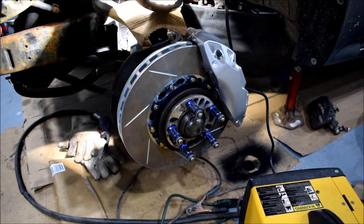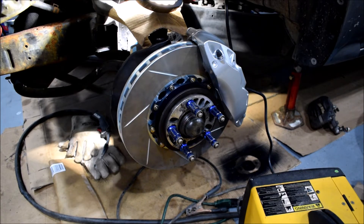I was expecting to post the completion of my big brake upgrade on the Tacoma this week, but unfortunately I'm not yet done. This project has turned into a massive multi-week undertaking. On the previous video you saw that I started out with the CTS-V brake caliper, which used the same size bolts as the stock Tacoma brake caliper — M12 — but unfortunately the holes on the knuckle and the holes on the CTS-V caliper were not the same distance apart. The CTS-V caliper had holes that were slightly closer, so I had to bore the holes in the knuckle even larger than M12.